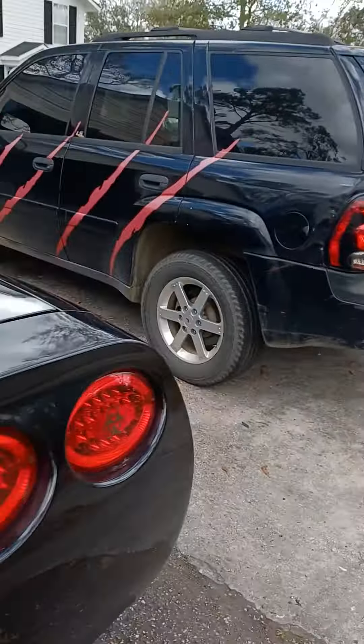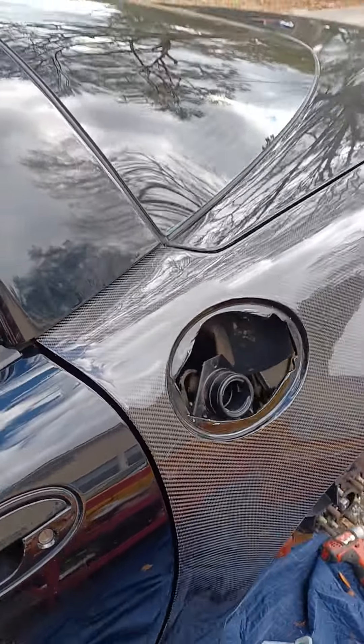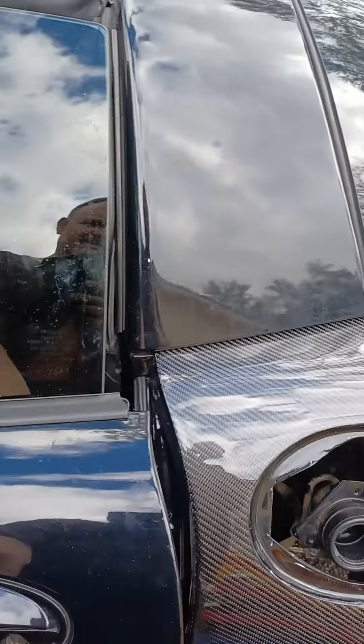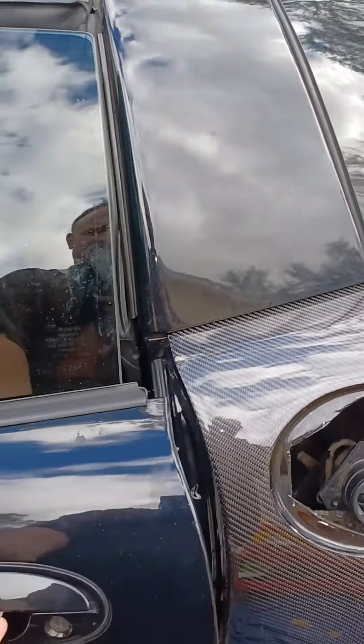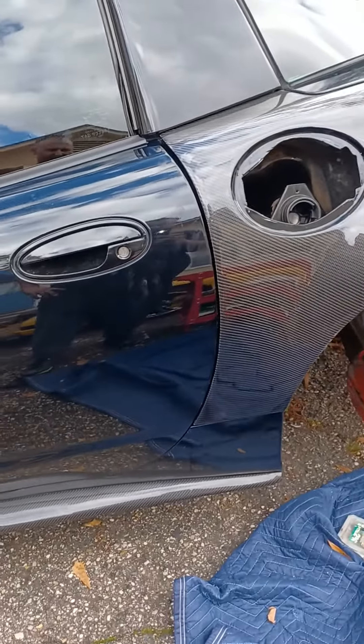Okay, this car has always had this dip right here. I don't know what from — I need to adjust this door one day. The other side's flush but this side you can see it. I'll straighten that line out because you can see how it's thick at the top and bottom, but I can get that pretty easy. Let me shut the door — there we go, much better.